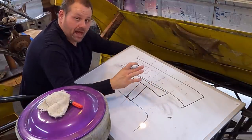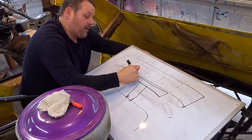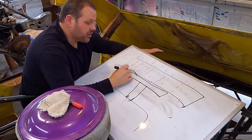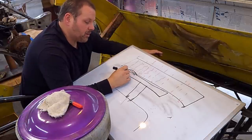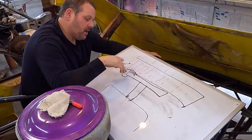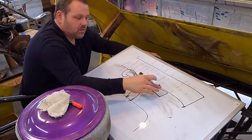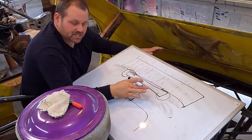Half inch gap, okay? Well, first off, air is going to wrap around. It's going to go in that half inch gap, okay? It's going to do it. You're going to lose this outside edge, a couple of inches of your fan. You're going to have air that's being turbulated around that end on each side. Now, that's going to happen, okay? Even if you had it at a half inch, it's going to do it.